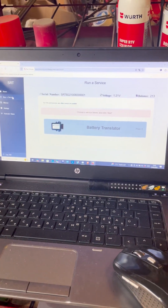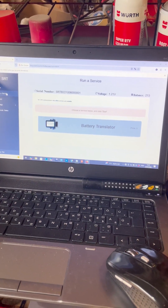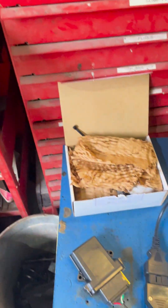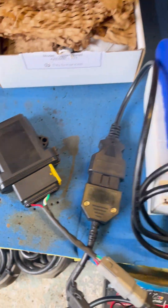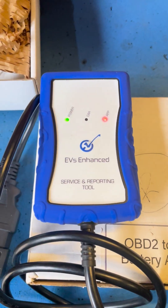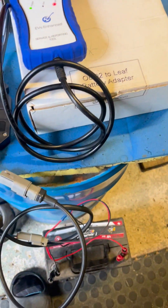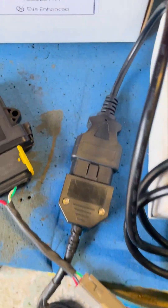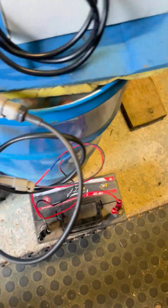Today I'm flashing one of the translator kits to be an AC charge limit kit. This one's for a 40 kilowatt hour car. This is the translator kit box which I flash using Eevee's enhanced service reporting tool and their fantastic kit to supply power. This would allow me to use LeafSpy on the loose battery with a different set of connections that I can just plug in.